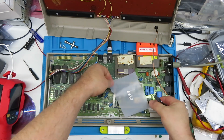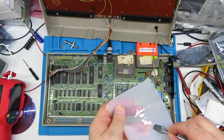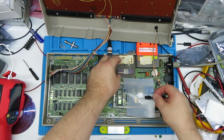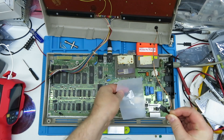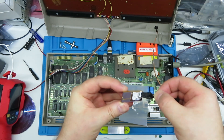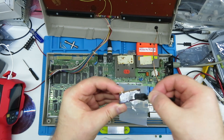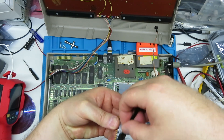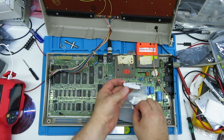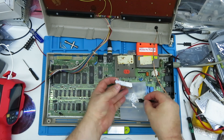So we take the VIC chip and scoop a big dollop of epoxy on it, going all up and down the chip. Normally I would use a very thin amount, but because the center of this ceramic chip is raised, I'm going to put a bit more to fill in the voids better. This is not an ideal chip to be doing this to purely because the center is raised, so plenty of epoxy either side.